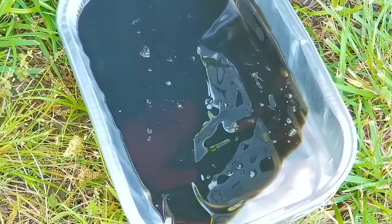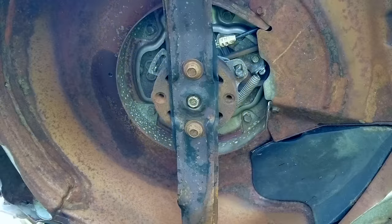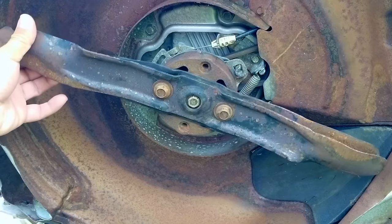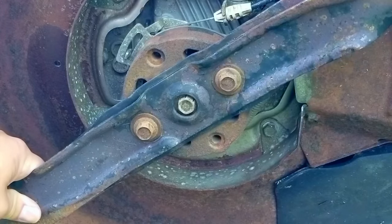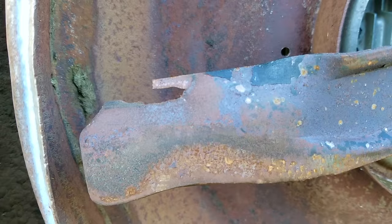To keep your oil from looking like this I would suggest changing your oil each mowing season. I'm going to be turning the blade by hand and I'm not worried that the engine will start because the kill switch is in the off position and there's no gas in the fuel system either. On this style of clutch, when you turn the blade the engine is not supposed to be rotating, but here's our next problem. As you can see, the bolt in the middle which goes to the crankshaft is actually spinning, which is not supposed to happen. That means we have a clutch bearing problem. We need to remove the clutch and inspect both bearings to see if they're working like they're supposed to. I also see that the bottom blade of this dual blade system is damaged from wear.